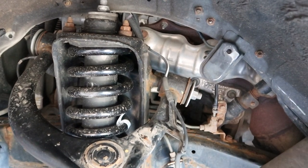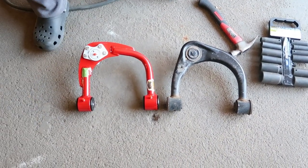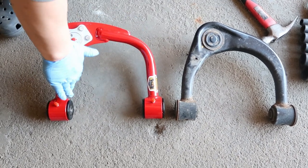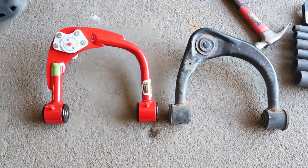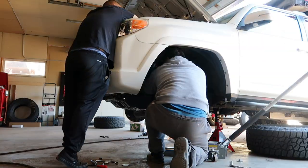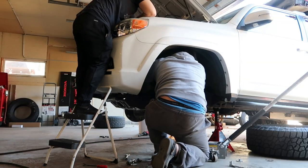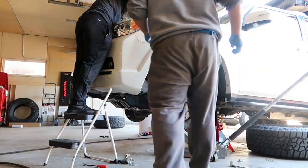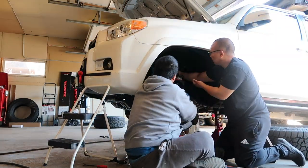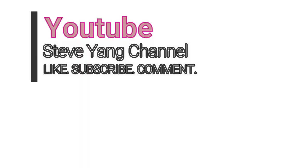This stock one won't even fit, dude. The main difference here is that this one has a wider and deeper arm that goes down — it won't hit the spring. The next few steps are very hard to do alone and require two persons. One person must feed the bolt through the top, and one person must hold the upper control arm steady with the bushings in place. Once that's done, the person on top pushes in the bolt, then you tighten up the nut on the rear and torque it to spec — I believe the torque spec was 85 foot-pounds. Again, thanks for watching the Steve Yang channel. Please like, subscribe, and comment. Thank you.